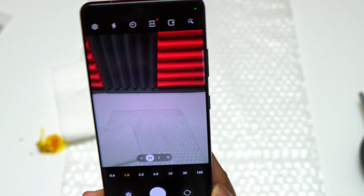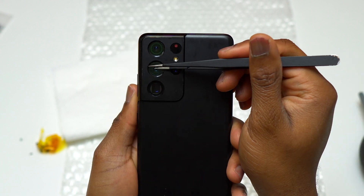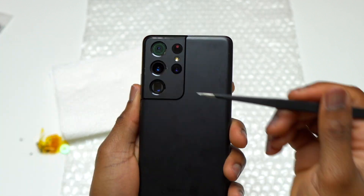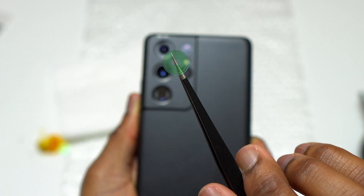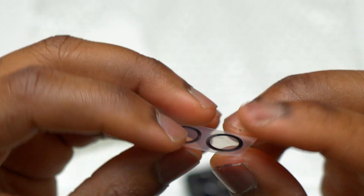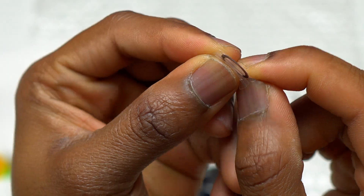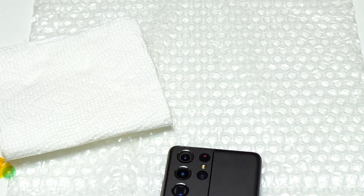Both cameras have been covered with the double-sided tape. I just need to remove the green plastic on top of the tape. The camera glass and double-sided tape you receive may not look like this, but it is the same principle. I personally think this design is not ideal because there is too much chance of touching the camera while removing the green film. If you have this type, make sure you do not touch the camera module while removing the green film.